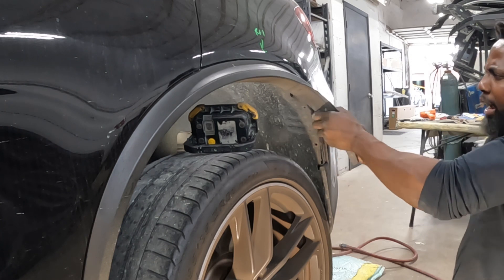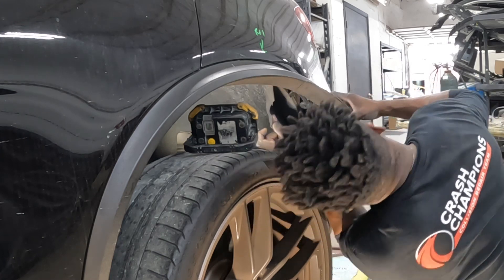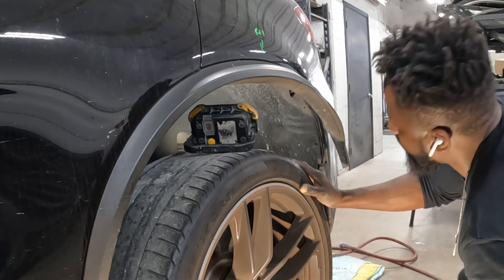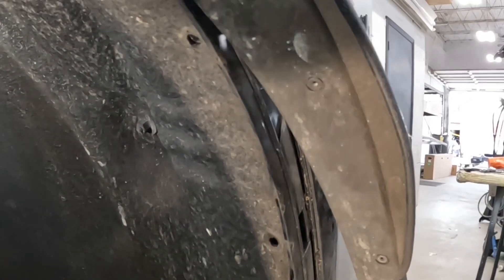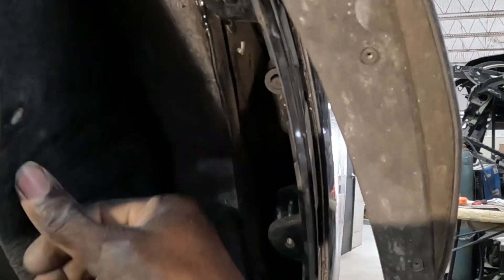See that guys — just grab it, peel it back. All right, the screw is right there. These are hidden screws but once you get this piece out of your way, go ahead and set this back. See the screw right there — that is a number 8. Take that screw from right there. Not only that — you see the clip down there, it's another clip. Go ahead and take the clip from right there as well. Take the screw and the clip from there.